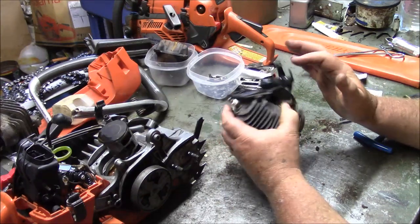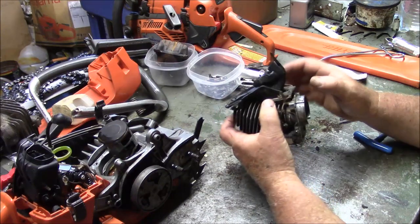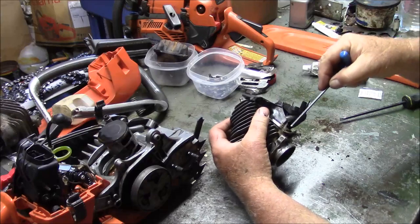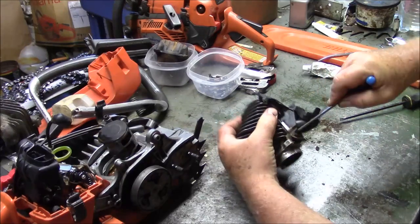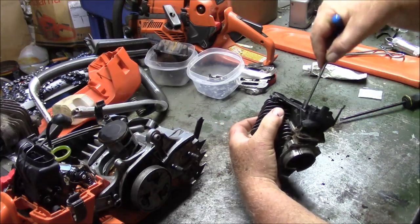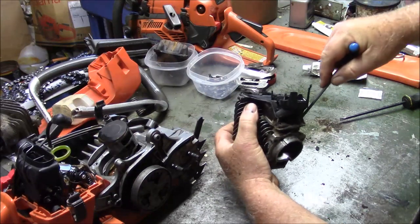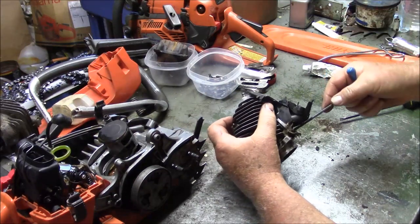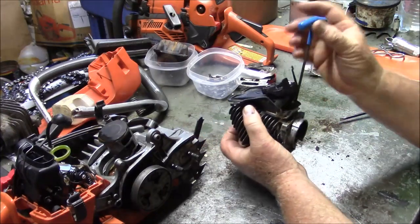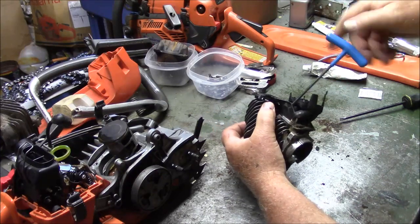And the second thing is, in order to do the modification on the flange, I do have to pull this whole intake off. And that also comes off with four screws with a 4mm. And there's this kind of a rubber O-ring arrangement inside there that actually does a fairly good job of sealing. I don't know whether or not I'm going to go to the extra step of adding 1194. I haven't decided. Probably not. I haven't had any problem with these at all that I know of.